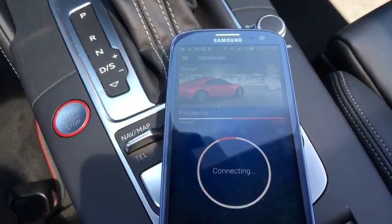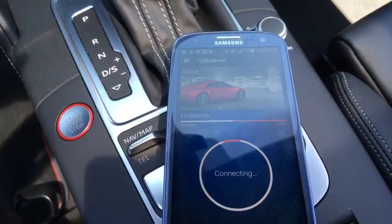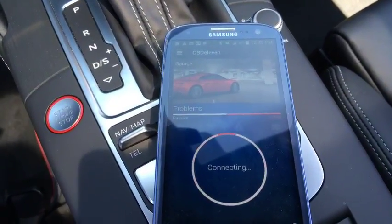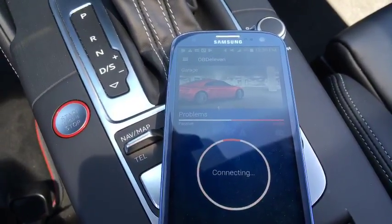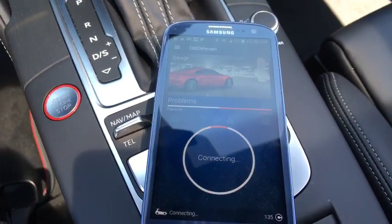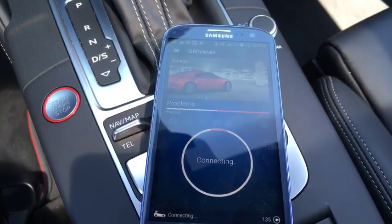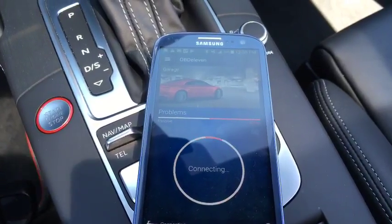So when you change it from 7.1 to the 12, it's not triggering that if statement. So the car just constantly runs. So you're kind of just overriding that little software coding in there. I have seen no negative drawbacks of doing that, and I'm really glad I changed that over. But again, I'll put some directions in the description of this video on how to do that.